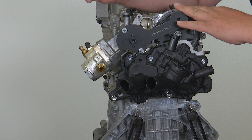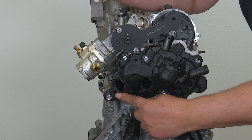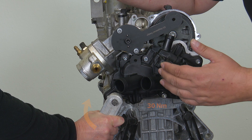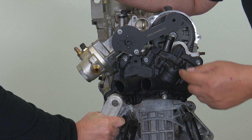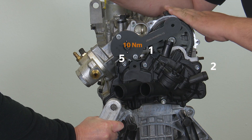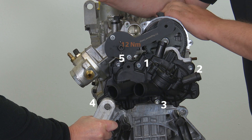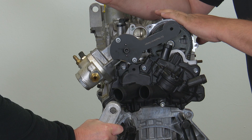This is where you need the help of a colleague. Here at the bottom we have a hexagonal recess for a 10 mm hex key. We insert a torque wrench into this and apply a preload of 30 Nm on the water pump. This 30 Nm of tension must be maintained until the water pump has been completely bolted into place. You now proceed to tighten bolts 2, 1 and 5 to 10 Nm, and then 3, 4, 5, 1 and 2 to 12 Nm, in that order. The timing belt will then be tensioned correctly and you'll have completed installation of the water pump.